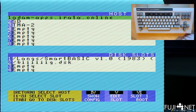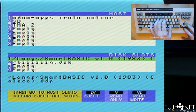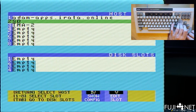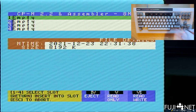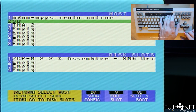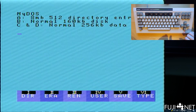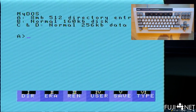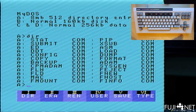If devices are active on the bus, we disable the functionality on the FujiNet automatically and as dynamically as possible, in the hopes that we don't need a configuration menu where you turn certain devices on and off. We'll clear the slots again, mount CP/M read/write, and boot in. This CP/M has drive B set up as a 160K disk. Looking at the files, we can see a number of files beginning with the letter F — these are the FujiNet command-line tools, or FNC tools.